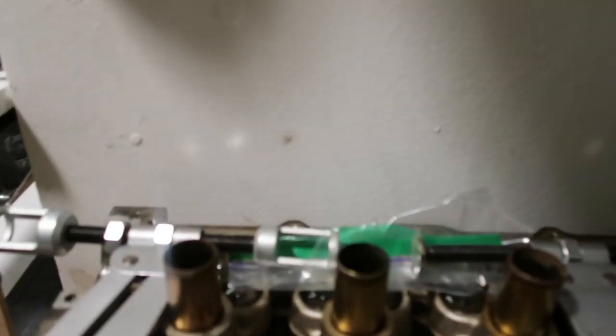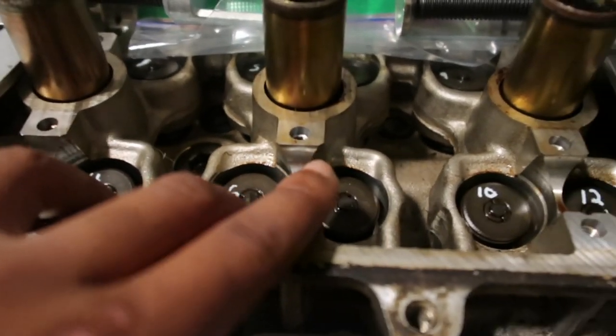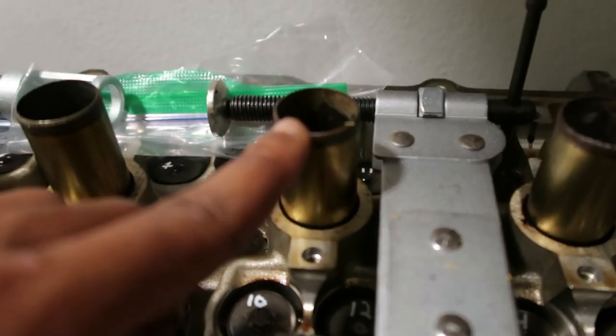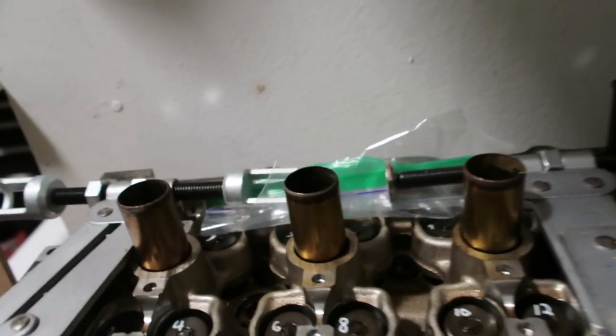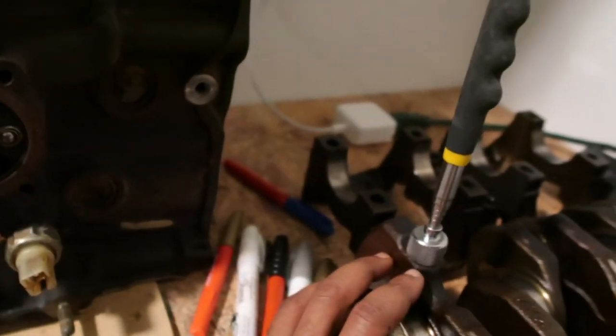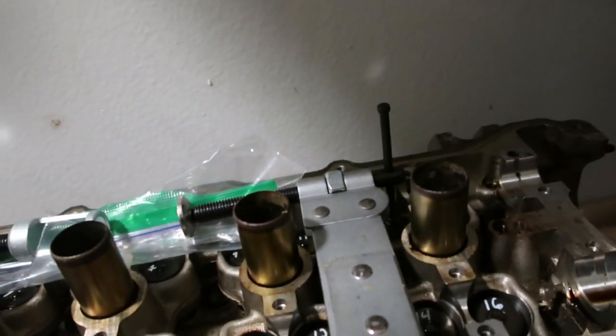The only thing I have left to do now is to just remove the valve springs and the valve stems, all this little stuff in here, all the valve train stuff. And then I need to get newer spark plug tubes. That's what they call them on the website when I'm looking it up. The next step now is to clean this stuff up in preparation for it to be rebuilt. And I'm putting brand new everything in there except a crankshaft. So yeah, brand new every single thing. Well, as much as I can get, because some of the stuff is not in stock, but just a small amount. For the most part, everything is in stock. So yeah,